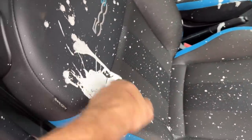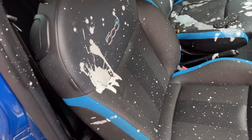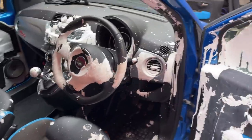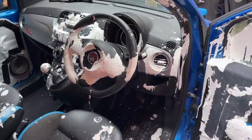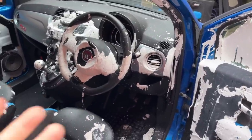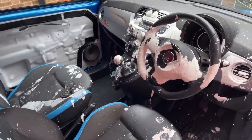I've broken off what I can. Some of these bits will still break off. I'm going to try on various places, softening it first. I thought about the heat gun then thought no, I don't want to damage the seats. Obviously if I heat it up it might make it go wet again which would make it more difficult to get off. Hot soapy water is probably going to be the best thing. Failing that I'll try the IPA — the isopropyl alcohol, not the beer. I'll try whatever substances I've got that I can get this off with. Some of the bits I'll do in situ, some I'll take off, like the gear knob. You tend to damage those gear knobs when you take them off. I could buy a new gear knob — 12 quid — but if I can get it off, it all saves.